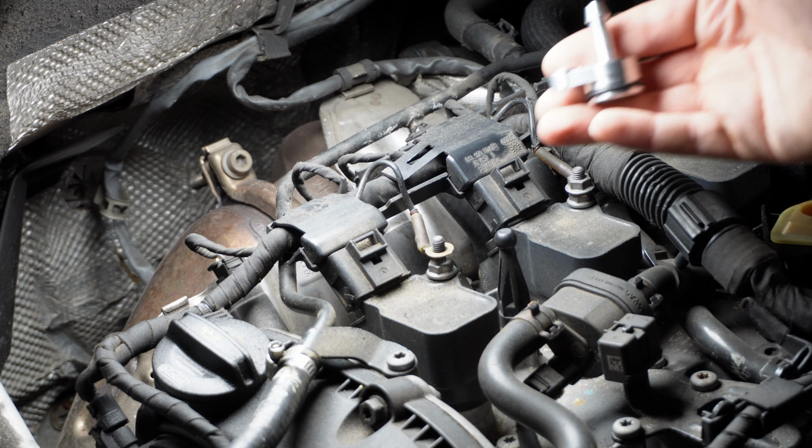Now, what I can say for certain is if it leaks, you'll never know because of this little guy right here. This is the hot side of your turbo, this is your downpipe, and this is your impeller section where boost is made. Anything that leaks from here is in this area where on average it would be about 400 to 700 degrees if you're really pushing the car. So any coolant that's there is going to disappear pretty much instantly, which is why you wouldn't notice if there was coolant leaking from here, especially if it was just a little drip.